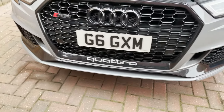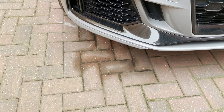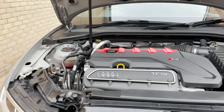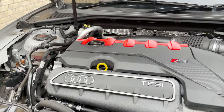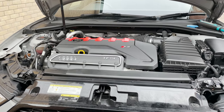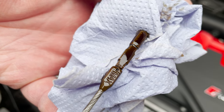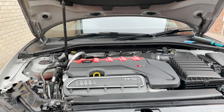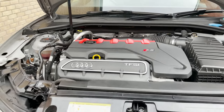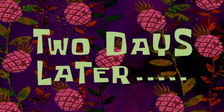We've had a good look. It's really hard to show you, but it's literally around the whole sump. I think this area here — what causes concern — actually I think it's just water. It's not actually the concern, but it's actually the oil. Thankfully, just before I picked this up it had a brand new oil change, so it's got plenty of oil in it. I don't think it's done any damage. We looked on the dipstick and the level was fine. So yeah, just getting it in now — possibly over to GT101 or Pinnacle, depending on who can get it in quicker. I'm just glad that it's not coolant, because I think resealing the sump is easier and cheaper than a new water pump. Two days later.